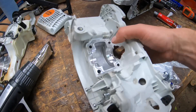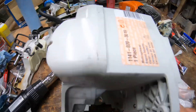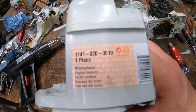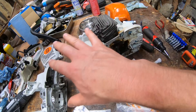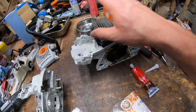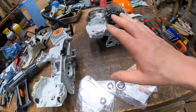This is the new case. You can see it comes with a new lower. Part number on the new case through Stihl: 1-1-4-1-0-2-0-3-0-1-9. We're going to be reusing a lot of parts when we do the full assembly in the next video, but today we're just pulling the motor out, putting it in, with new seals, new bearings, and going forward.